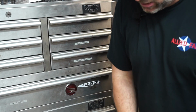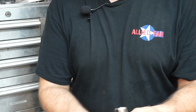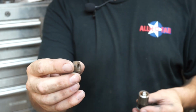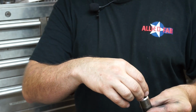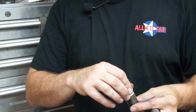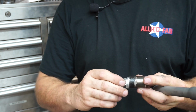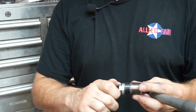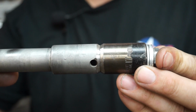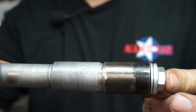Ooh, that's hot. So we're going to take a socket, we're going to take a bolt, we're going to take a nut that's 17 mil, the OD, and this one's rusty, and I specifically picked this one because it's a tight fit in here. A nice clean 17 mil nut rattles around a little bit, but this one has just a hint of interference. So you got the rusty nut in there in the hex, so it's going to keep the flat sides of the hex lined up, and then we can weld that.